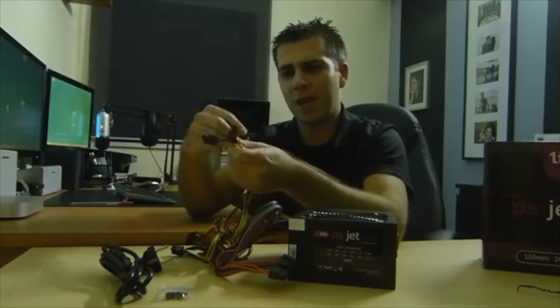I'd like to start by telling you a few mistakes I've made over the years. I've bought cheaper PSUs in the past, and the only thing I think now when building a system is that I need a PSU comparable with the system I've got. Usually we build really nice premium systems and then choose the cheapest PSU available. I've done that and we end up with terrible cable management, really loud systems, and most importantly, component failures due to electricity issues from a very cheap PSU.